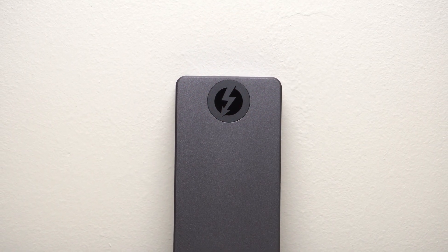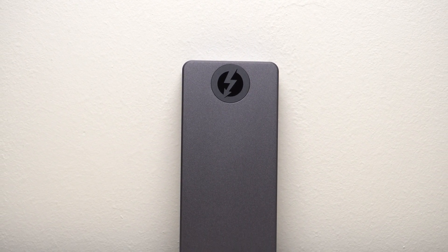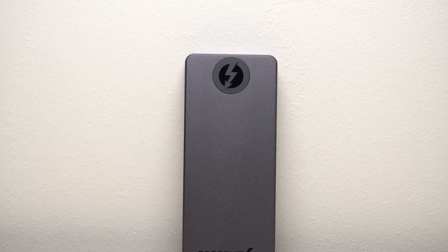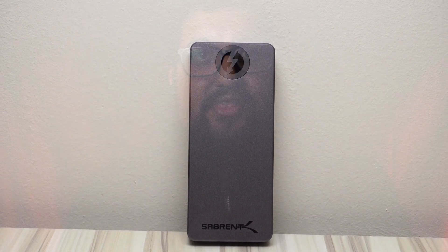The final drive is probably the best looking one with a nice matte black finish. It's another Sabrent option — an all-in-one NVMe Thunderbolt 3 solution with no cap, running the full 40Gbps. At £200 it's the most expensive we've looked at, but that's the same cost as moving from 256GB to 512GB with Apple's storage options, and this thing is absolutely rapid. Read speeds are extremely close to Apple's internal drive, and while write speeds are only about half as fast, they're still extremely fast. It's also backwards compatible with USB 3.2 devices at about 900MB/s, giving you flexibility across Thunderbolt and USB devices. The speeds are stunning.